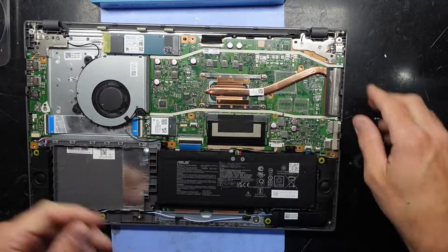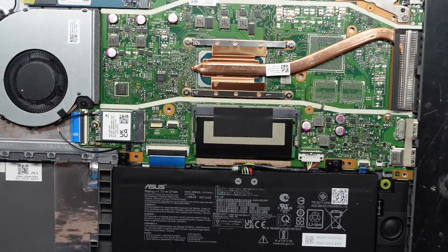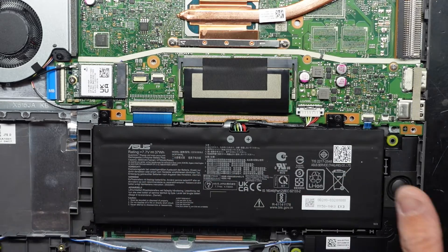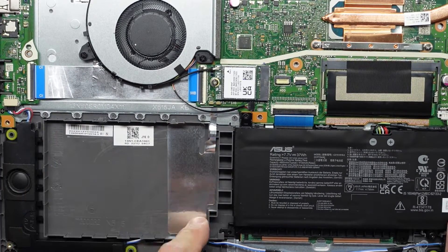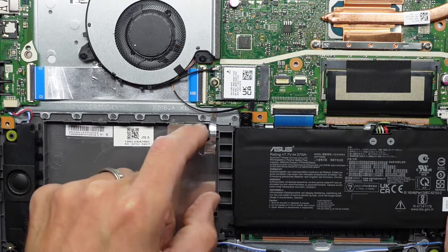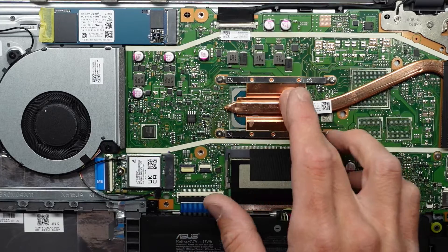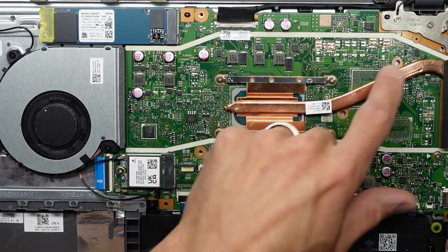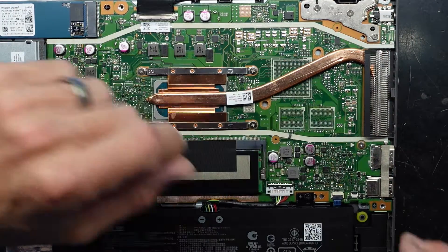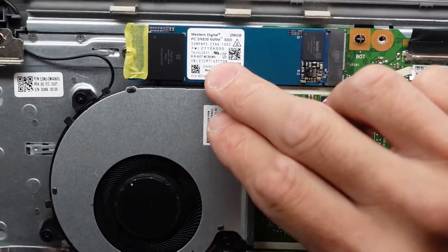Let's zoom in for a quick overview. I can see one stick of RAM, one removable battery that's very tiny, and room for possibly another hard drive — though I'm not seeing the connector for a potential 2.5-inch drive, which is slightly bizarre. We also have a replaceable fan. The processor is very low wattage — look how far the heat pipe has to travel to reach the copper cooler. Thermal paste on there should still be okay. There's a 256 gig NVMe drive.